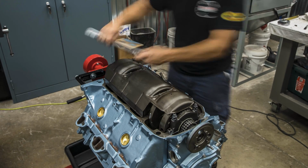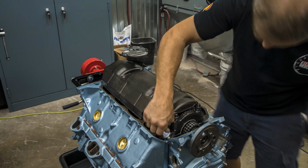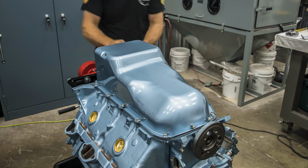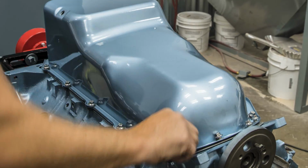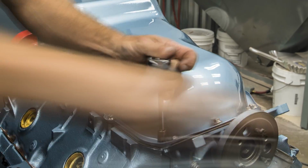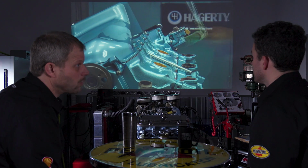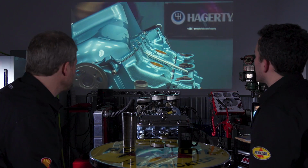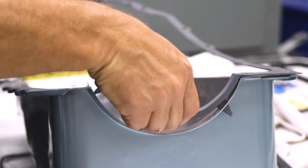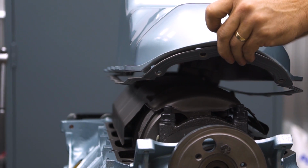Of course, a brand new oil pump. It's silly to reuse an oil pump. And a brand new oil pan because we didn't have one. Well, we had one, but it had a lot of crust to it. It was pretty holey. You can see the little wrench that you had to use at an awkward angle to get those, and even getting them torqued was kind of awkward. And that was a one-piece seal as opposed to a rubber seal. I can drop that clip in as well. I didn't have it in here, but I remember seeing it in the edit, of watching the gasket come in and sit around the pan.